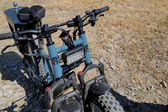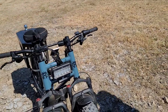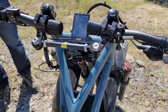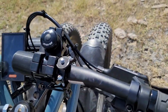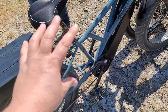Yeah, that was also something we were working on. If you go too far apart, then you have the problem that ATVs have — you have to do this counter-balancing, and if you go over a bump you're gone, and that's super dangerous. We wanted to get them as close together as possible to get stability and control in soft terrain, but not so close that you couldn't turn. We derived this mathematically to figure out what the optimum width would be based on a bunch of factors.